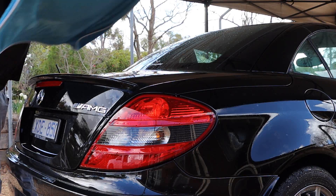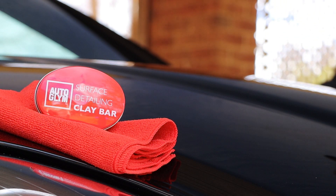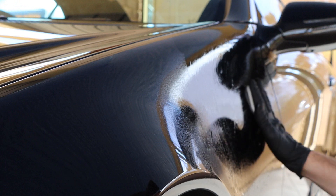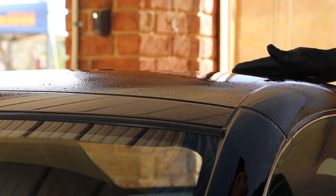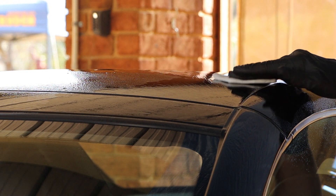The car was starting to feel smoother and obviously look better, but there's still more to do. I cracked open Autoglym's surface detailing clay kit and using their Rapid Detailer as a clay lubricant, I worked over the entire car. With no pressure and straight motions, I had the clay bar gliding across each surface until it felt super slick. This whole step was the final stage in removing any existing contaminants, helping for a superior bond for the protective layer later on.